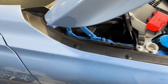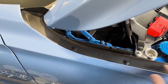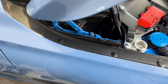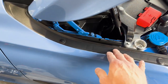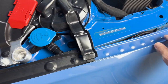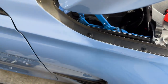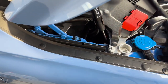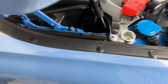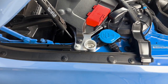One thing to note: there's a piece of plastic weather stripping that acts as a water rain protectant for the engine bay. Some of the collars for the fender bolts would go underneath this. I'm probably not going to remove it to put those in place — I'll just leave it on. The only ones exposed on each side that I'll do are the visible ones. The few extra collars I'll have left over I'll keep around just in case I need replacements if one gets damaged.